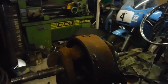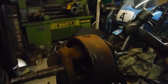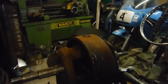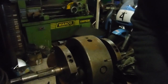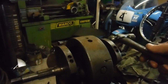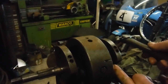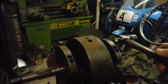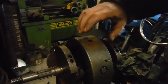This crank is cracked across the inside of the big end journal, and this ironically is the crank that I removed from this blown-up engine when I worked on it about four years ago. Let's put the big end journals down at the bottom to be fair. Notice how dull that is — because there's a crack running through the big end on that side. That's what a cracked crankshaft sounds like.